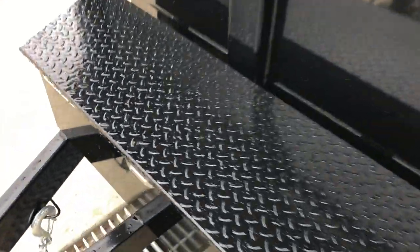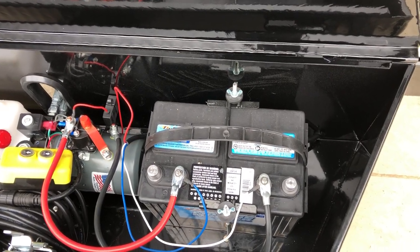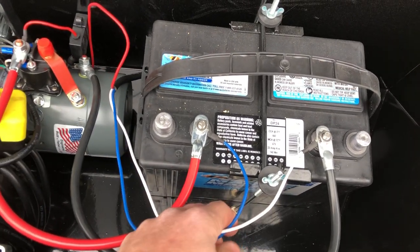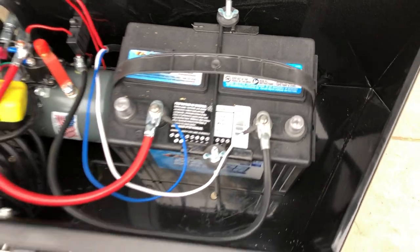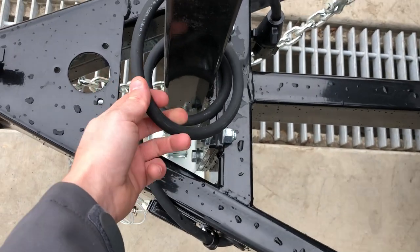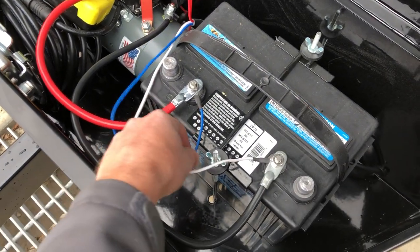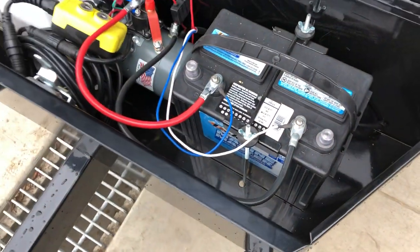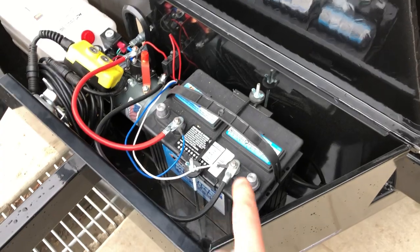While we're up front, let's also take a look at the toolbox. It's got a diamond plate lid instead of the traditional smooth. They're currently using a KTI pump with a DECA Deep Cycle Marine battery — we've had very good luck with the DECAs on these. There are two extra wires: one is an auxiliary line that charges off your truck. It provides about a 3.7 amp-hour charge via a 14-gauge wire. Some folks think whenever you plug this into your truck that the whole line runs direct off the truck — that is incorrect. You're going to run this off a self-contained deep cycle battery. The little bit of charge you get off the truck is via this line.